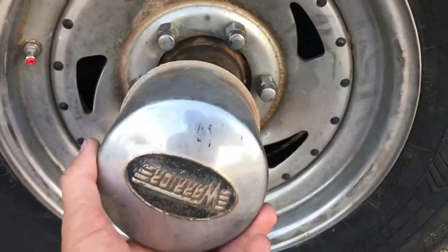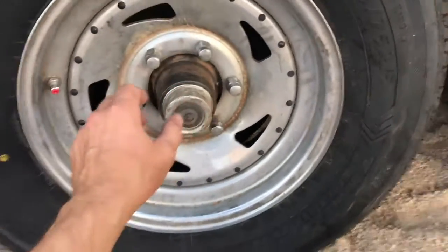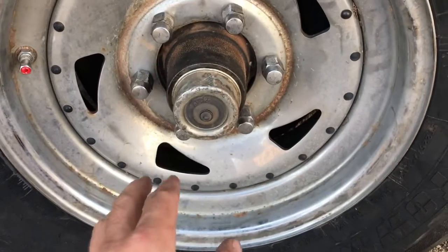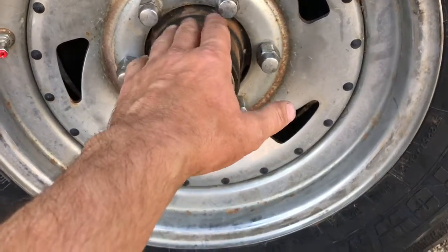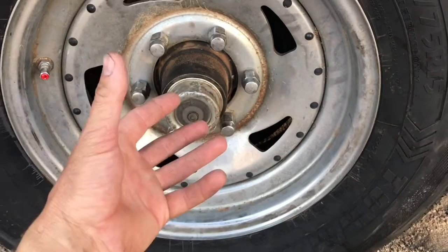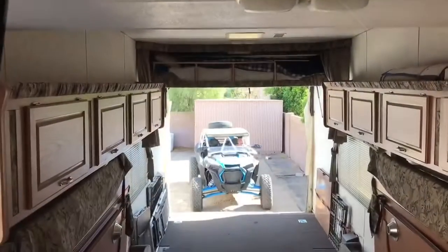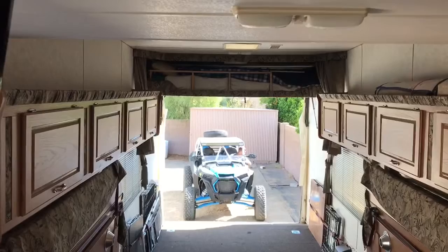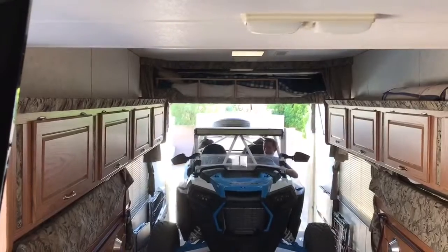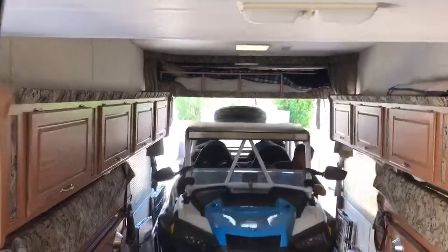I like to remove my hub caps and here's why — when I'm pulling this trailer and stop to get fuel, I like to quickly touch each one of my hubs and make sure I don't have one hub getting a lot hotter than the rest. That way if I do feel that, I know I've got a wheel bearing problem starting to develop and I might be able to take care of it before I see a tire and wheel go flying down the freeway. Hopefully this video helped you out guys. If you enjoyed it hit like and subscribe to my channel. If you have any other questions about anything we covered in this video and want a little more detail, let me know in the comments and hope to see you next time.